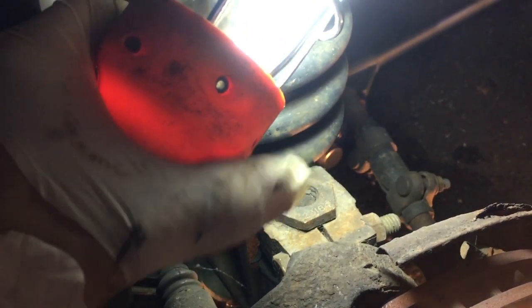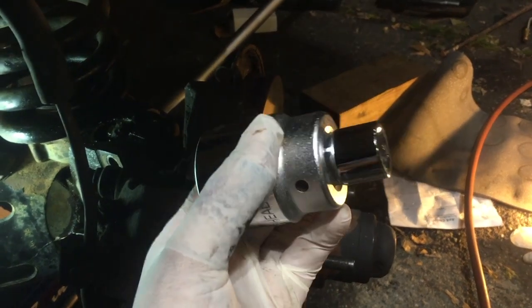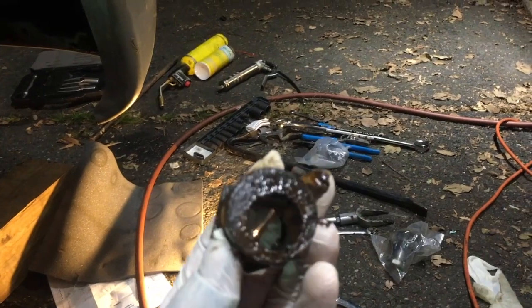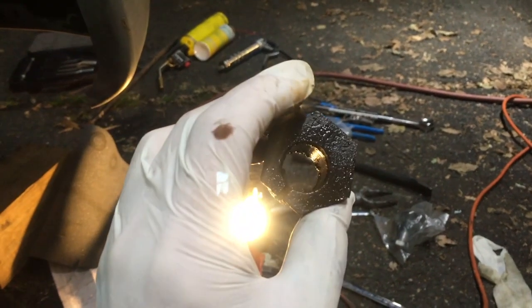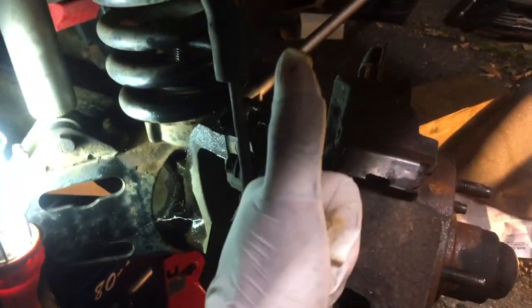If you own an impact gun, your life's going to be amazing. I hooked it up to my impact gun, spun it for about 10-12 seconds, and boom — the nut popped off. The other side took me about 10 minutes by hand, where this took about 20 seconds. So that's the real fix. Now with it off, you have access to your top ball joint, which on this is really really wiggly — I take that as a sign it needs to be changed.